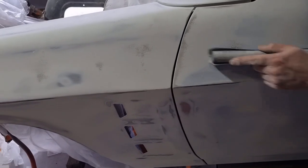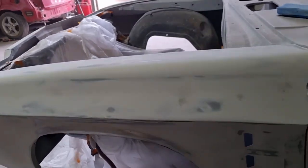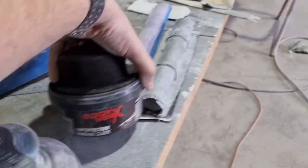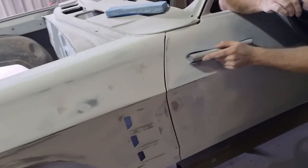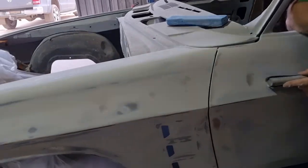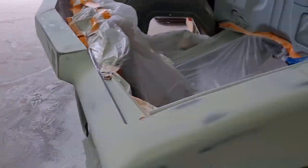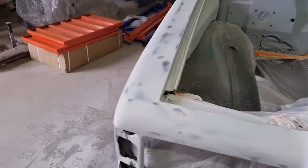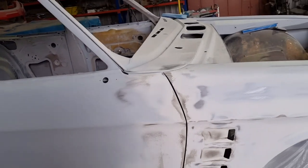So you can see we've rubbed it all back. That's just one coat of polyester. Put our guide coat on it. That stuff, that bodywork's guide coat. We really just wanted to see where all the lows were, and you can really see them. We found them. So now what we'll do is we're going to mix up some dolphin glaze